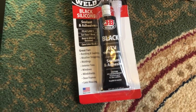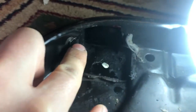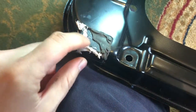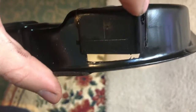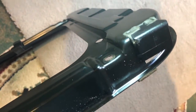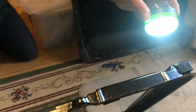We need to take these out, clean all this up, then use some sealant remover on it, and then use some JB Weld black silicone — it takes about an hour to go off, that's why we're doing it inside. It looks like they put sealant underneath the piece to hold it in around the sides. Flipping it over, there's also sealant here — this white stuff is a repair that was done. We're going to mimic that and seal it to keep a slight gap.